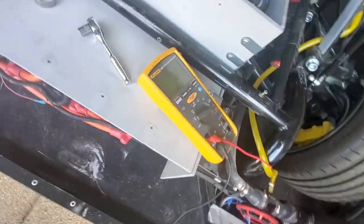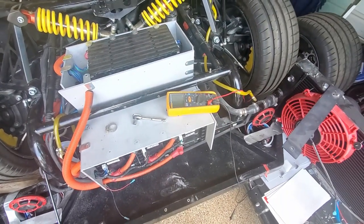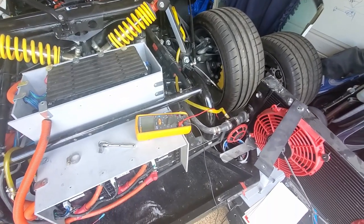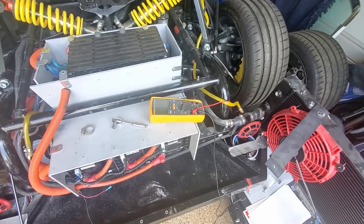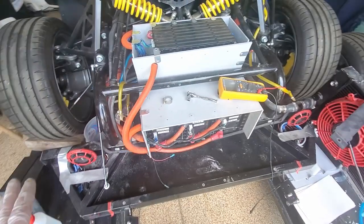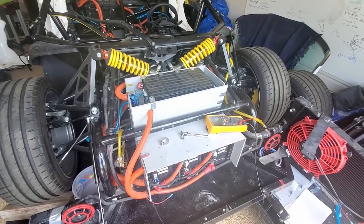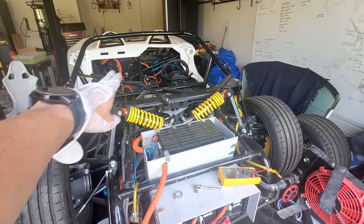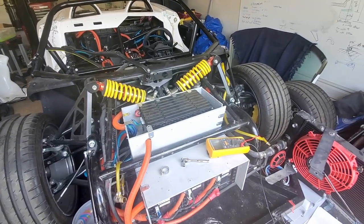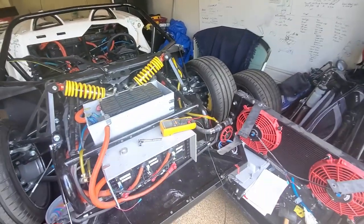We're now up to, is that 1.2 gigaohms. So when I first started, we were at point something megaohms. So we've got like, I'll call it 1,000% improvement. So in theory, knock on wood, I never want to claim this is done, but man, this has been a long journey. So I'm gonna button everything up, get both packs connected, do one more test, make sure we're good, and then confirm the controller's good. And I just want to put everything back together and go out for a ride.